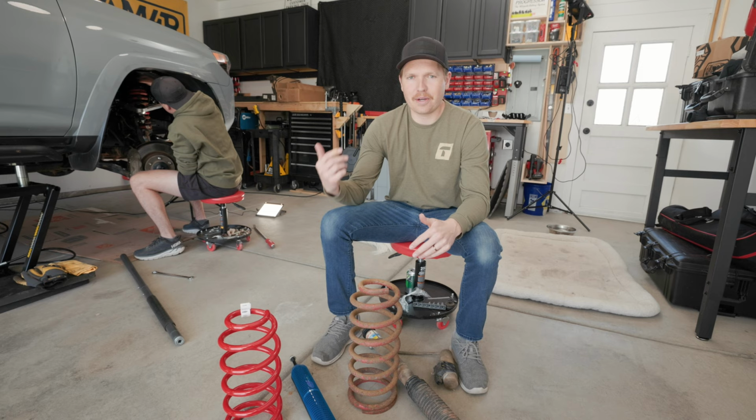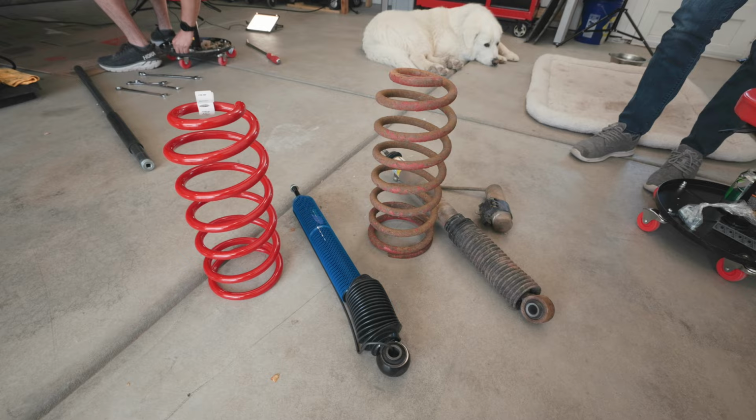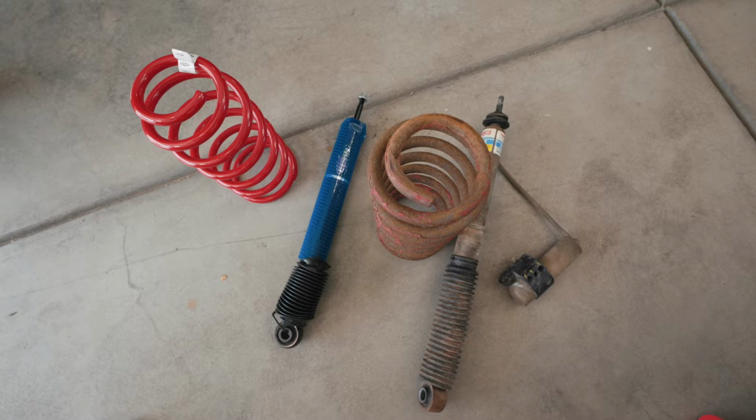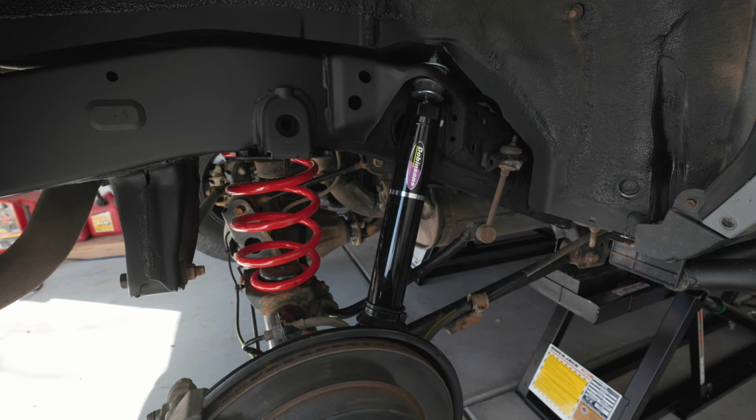Quickly talk about the rear of the suspension. Clearly we're swapping this all out today, so we've taken off the old TRD Pro suspension, the Bilstein stuff, 70,000 plus miles on it, hard miles off-road, on-road, so it was time to swap these out. And also these rear springs, when we initially lifted this truck a few years ago, we put a stiffer spring on, which wasn't the solution. So we not only wanted to swap out the old stuff, but we wanted to swap it out with an upgraded solution. So that's why we went with Dobinsons IMS.